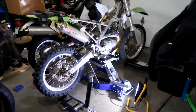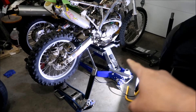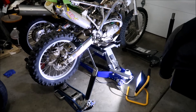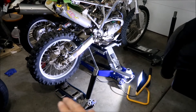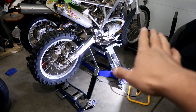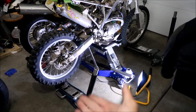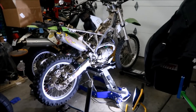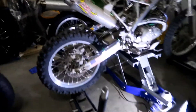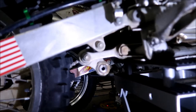Welcome to this strange apparatus. I've got a Harbor Freight motorcycle lift jack and two other Harbor Freight stands holding up the wheels. Basically, that stand is there because the bike wants to flip forward when I move one side up. The other side should swing freely — there's no shock installed right now. What we're gonna do is flip the linkage. Nobody has made a video on this.